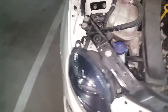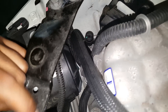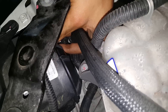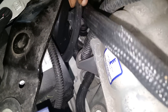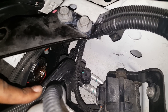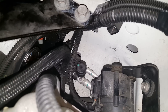On the passenger side of the vehicle — this is a US spec car — same deal, except this side is a little more difficult because the coolant overflow tank is there, making the space a little tighter. Just get your hands in there and twist the headlight cap counter-clockwise until you hear it pop out, then wiggle it out. Turn the factory bulb counter-clockwise, pull it out, and separate the gray connector the same way as the other side.